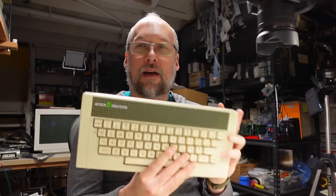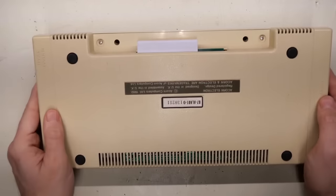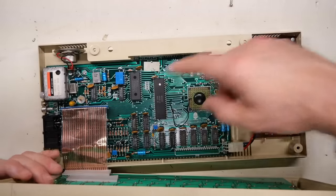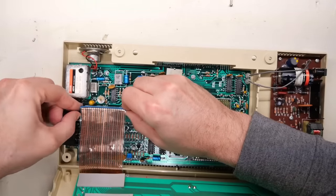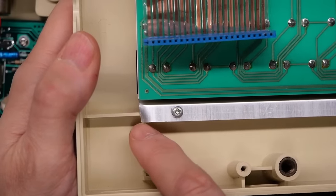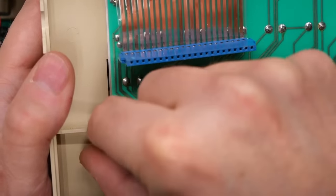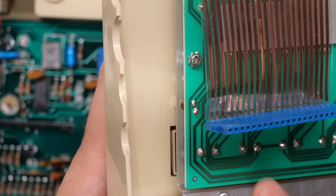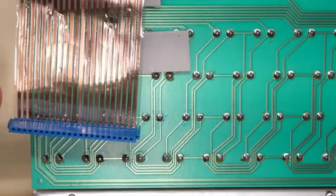Let's open this thing up. Just four screws on the bottom. It's got one of those ribbon cables, though it looks like there's a regular pin connection so I don't have to pick the ribbon out. Interesting — the keyboard has an aluminum structure with a bend in the corner, like it's been dropped at some point. It uses a metal base plate and a PCB, which probably explains why it feels so nice to type on — pretty fancy for an inexpensive computer.